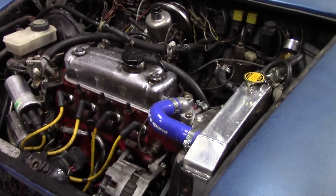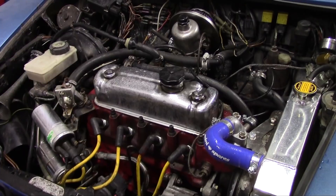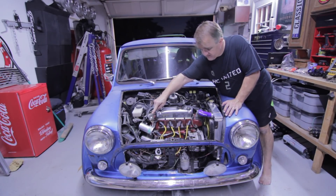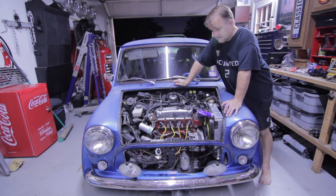I think it's blowing some smoke — I think it's burning some water too, as can be seen from the exhaust. And when I hit that contraption, it definitely sprays a lot of dirty water. I think that's related to the heater. It's definitely emptying the radiator. There also looks like there's some water coming out of the tailpipe, so perhaps the head is still leaking some water into the cylinder as well.